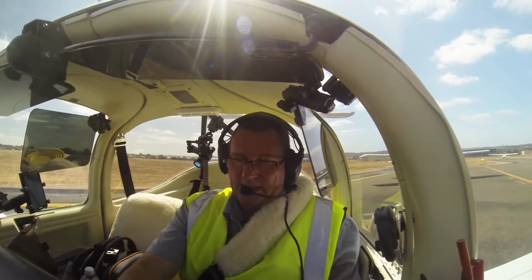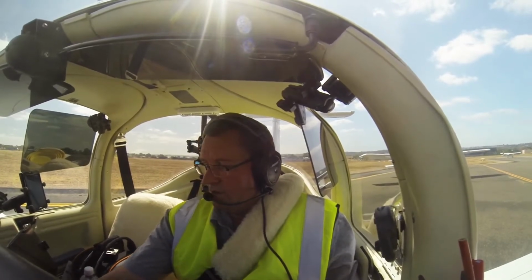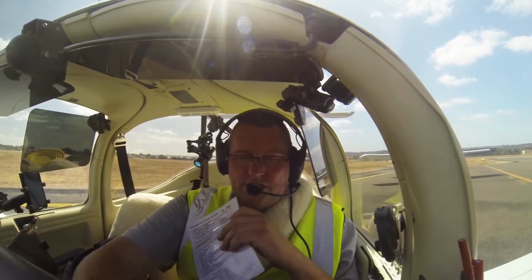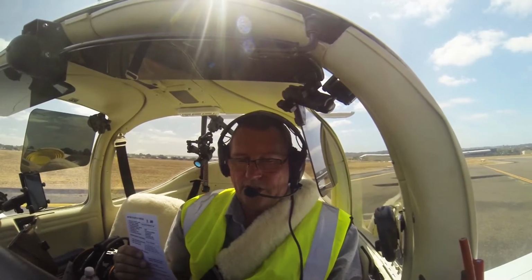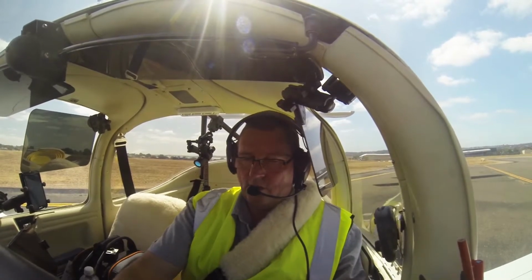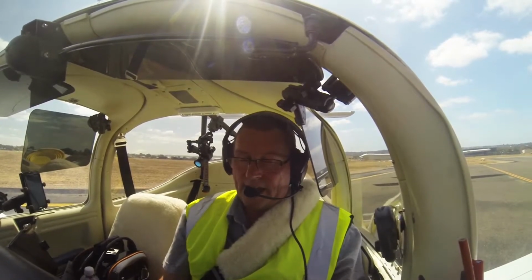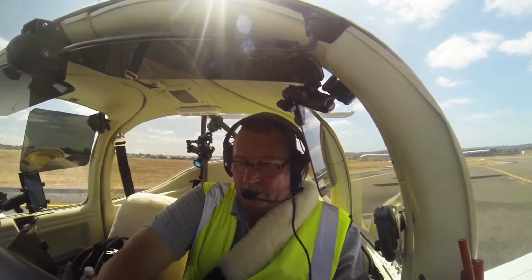Vacuum gauge we've checked, engine instruments okay, we're charging on our alt amps, we've got fuel pressure there, oil pressure, oil temperature's all good. Carburetor ice detection, so I've just tuned that, so we'll tune the light in, so the light is illuminated now, and then I'll tune that out there, so that's good. So that'll detect ice on our carburetor, gives me a second warning on this particular aircraft when to apply carburetor heat. We'll do our carburetor heat now, and we'll make sure that's working.